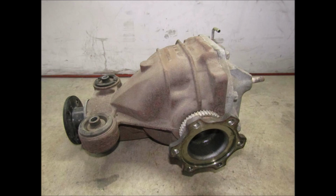So if you have a 370Z that has twin turbos on it and you want a longer differential ratio, you can get a 3.3 out of an automatic and throw it in there from an early 350Z that has a 4-bolt flange, and it'll match up to your manual transmission and it will make launches easier because you won't have as much wheel speed, and vice versa.